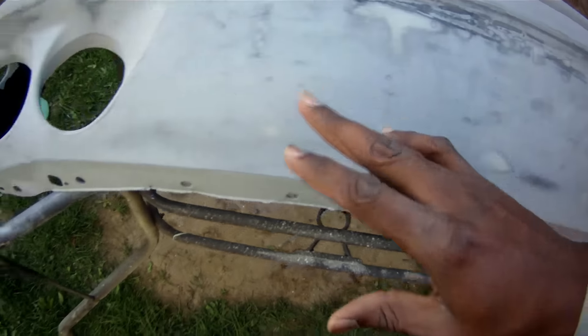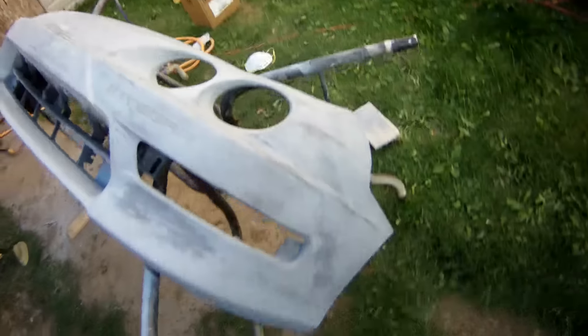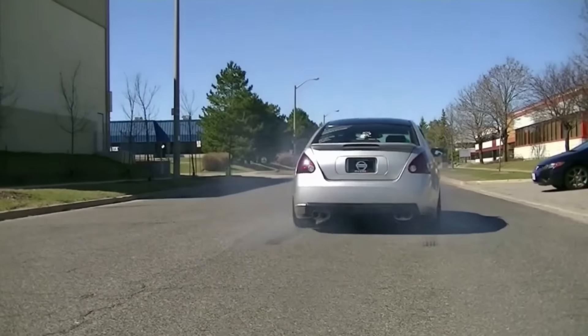Pretty much what I have to do next — probably tomorrow or some other day when I actually spray it — is scuff it down with a scuff pad and sandpaper, probably a 400 grit, to take off the primer. The primer let off a bunch of little spots; I don't think the can was warm enough, so it let off a lot of texture. When it comes to spraying, you always want the can at room temperature. It's been outside in my little shack, but so far this is what I've done — did a pretty good job.